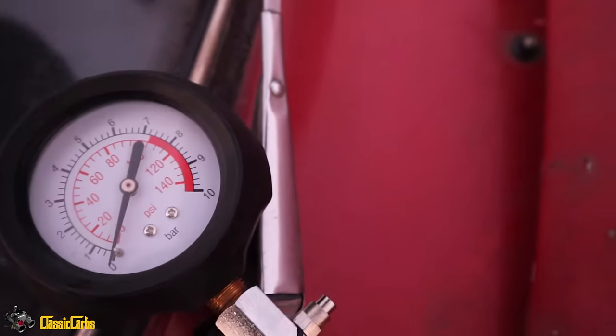I might be doing something wrong. No, I think I'm doing something wrong, guys. Well, it looks as though either the piston rings are worn, the fitting I'm using is not the right one and air's escaping, or the valves are stuck open, which I think's unlikely, but you never know. So I will make sure I've got the right fitting, and then I'll pop the rocker cover off. And hopefully the engine's still got life in it, and we don't need to rip it out and rebuild it. So, onwards and upwards. Chaps, I think I might have worked out what the problem is. Wrong adapter. Doesn't fit properly. Let's go and have a look.